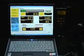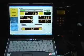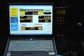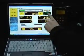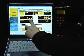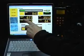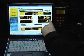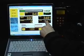Okay, you can see the pressure now is 680 millibar or thereabouts, manifold vacuum at the moment. The system hasn't actually primed yet. We're going to make the first change over to gas. At the moment we're running on petrol, benzene. When it goes to gas, here we'll say GPL. The first change, all we want to do is look at what the pressure does. We're looking for between 1.1 and 1.3 bar, 1200 ideal. And we have a quick look what the injector duration does compared to what it is on petrol at idle. At the moment we're seeing approximately 3.4, 3.5 milliseconds.